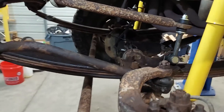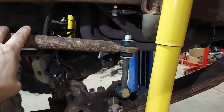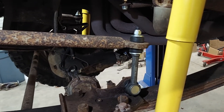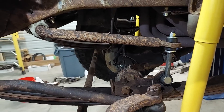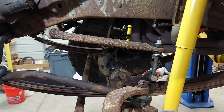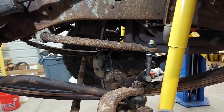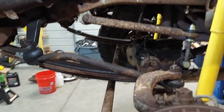We put the rest of the stuff just back to stock, and I went ahead and ordered end links — longer end links for a '94 Ram 1500. Saw that on the Ram Charger site; they said if you want to keep the sway bar rolling, just put those on. I'm hoping it'll help with the soft springs to get down the highway, but then we'll have to figure out a way to disconnect it to do a little off-roading. We'll deal with that later.